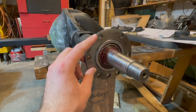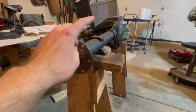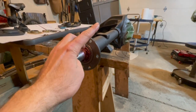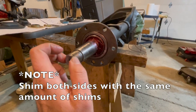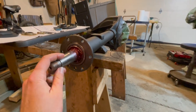Next step is shimming and we'll do the same steps on the driver's side. Moving over to the driver's side — this side is already complete and it's the exact same steps as we just did on the passenger side. Now we can continue shimming. You have to shim both sides at the same time to get the right end play, as these axle shafts are now interconnected with each other.